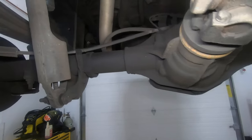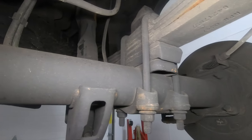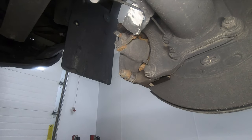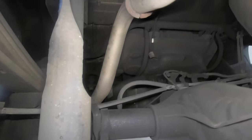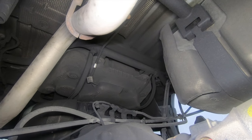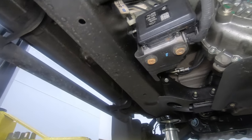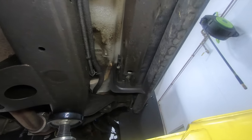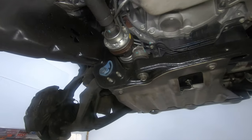Taking a look at the front of the axle — last year I sprayed the driver's side with LPS3, the passenger side got fluid film, and I really don't see much of a difference between the two. Another question I get a lot is why I'm not using Cosmoline. You have to look at the environment I'm spraying in — I don't want my floor, walls, lift, bench, and toolbox all coated in orange goo that I can't remove. From my yearly testing, I can't even remove Cosmoline with a pressure washer. That's why I'm sticking with fluid film.